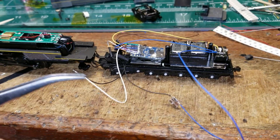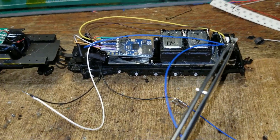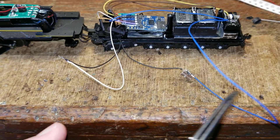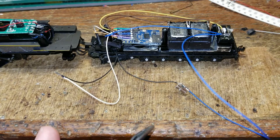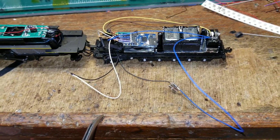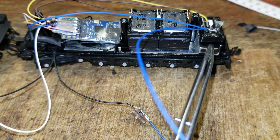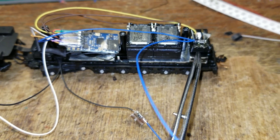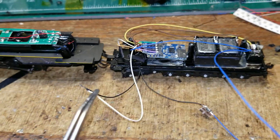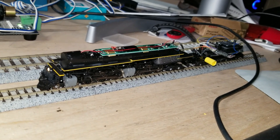I've got the rear light wired in — that's your yellow and your blue common, with a dropping resistor that was just a chunk of that Kato board. The white wire is your forward headlight, temporarily tacked there, with a little chunk of old PCB with a dropping resistor. The reason I haven't shortened it yet is because I've got a 50-50 chance of having it backwards, so I'm going to throw it on the test track first. It does look like everything will fit neatly in there — I made a little standoff so the LED sits at the right height using an old speaker housing print.